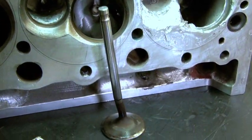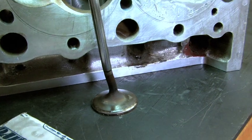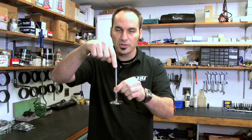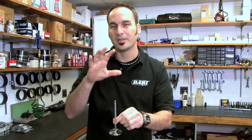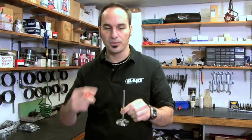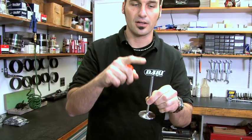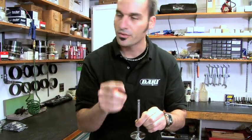You don't want it to look like this, or valves that look like that. What we're trying to do is load that valve and push it down and up as smooth as possible in a straight line. It doesn't always work that way — you're going to induce angles, and side angles are going to put loads and stresses on things and wear them out. So we're going to try to get things as straight and properly set up as possible.